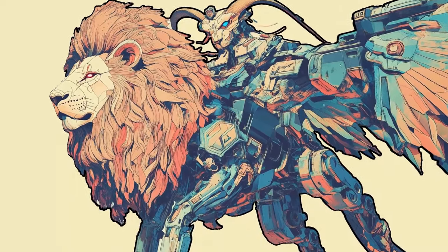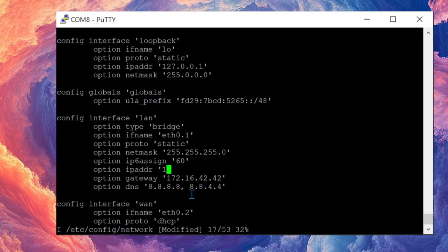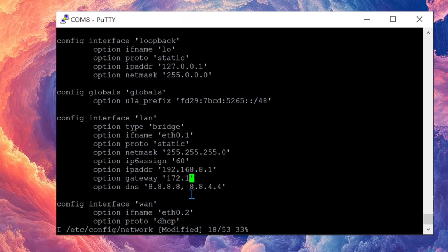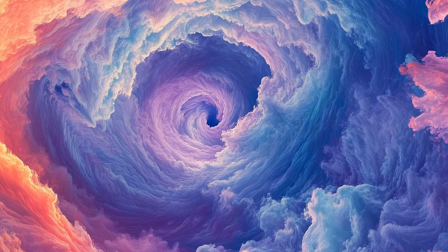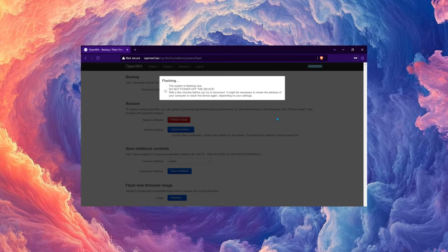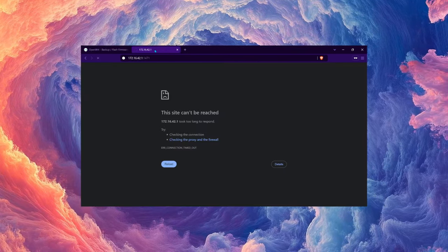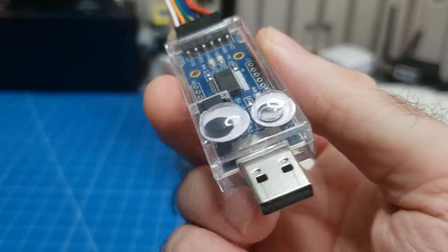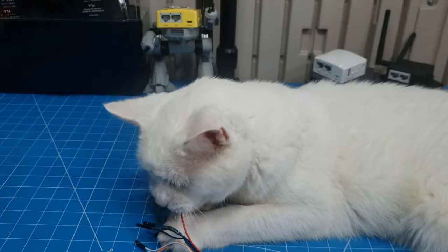This hypothesis was supported by the fact that upon inspection, the router's IP was still 172.16.42.1. After manually editing the IP, however, I was able to access the web UI and re-flash it. I was stoked that I was able to successfully use my USB to TTL adapter.